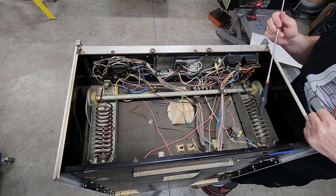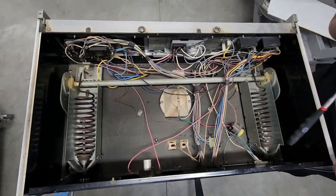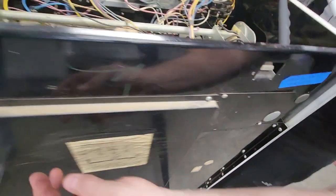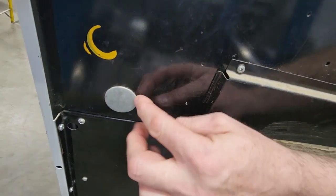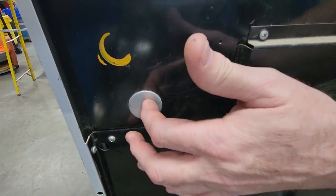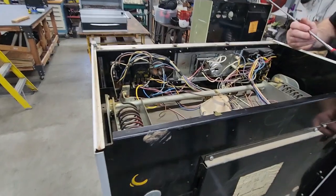On this '62, the hole to do your spring is actually right back here on the outside — it's this cap right here and this corresponding cap right here. You just pop these off, put your socket right in, and this hole corresponds to the back of the adjustment bolts. That's why these caps are here.